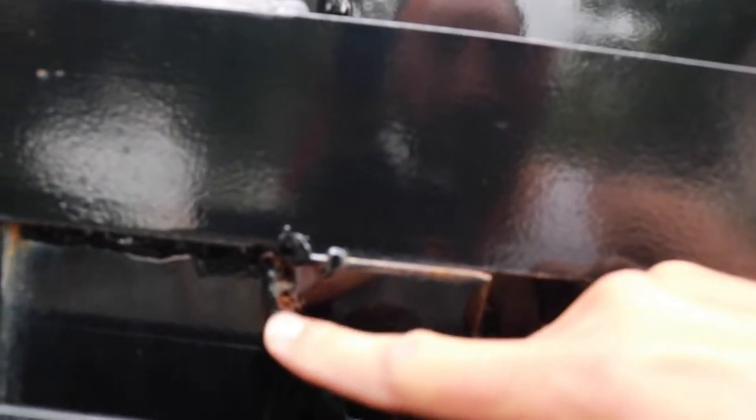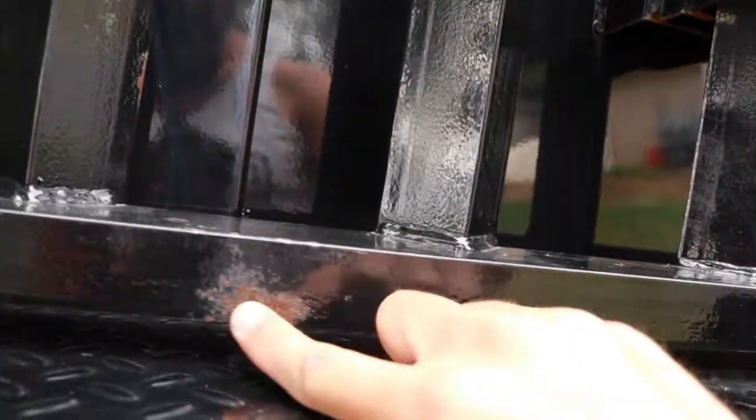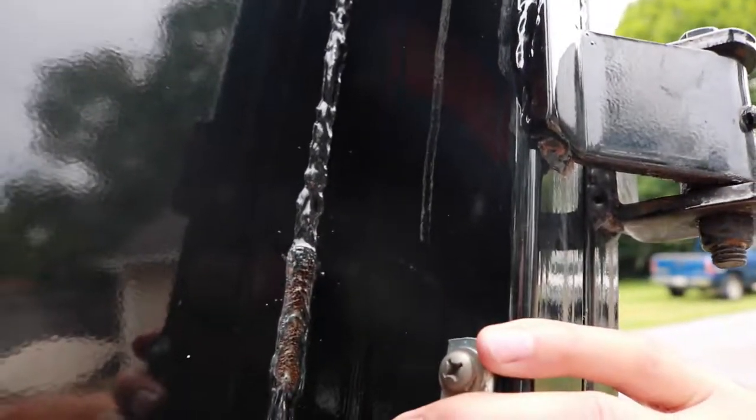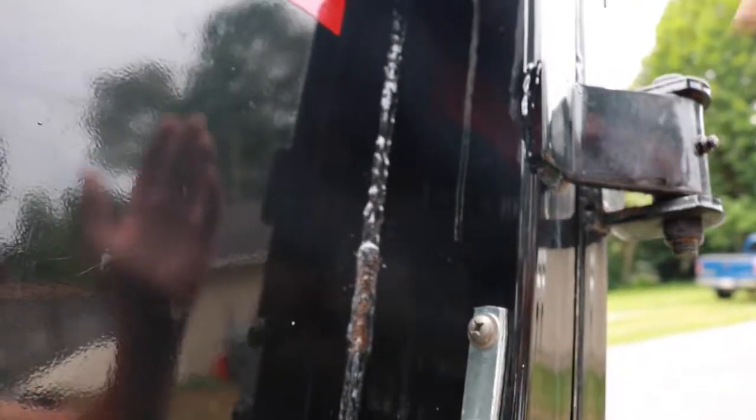As far as quality: this trailer is about a year and a half old and you can already see a lot of porosity in the welds and rust forming. The paint on this ramp is already rusting and I've never driven any equipment up these ramps. You've got big weld nubs, a lot of porosity, and weak welds in multiple spots. There's a really bad area back here on the body of the trailer where the welds are just not great at all.